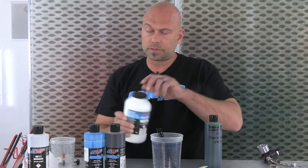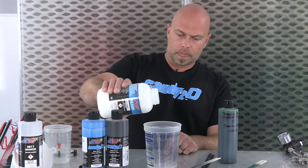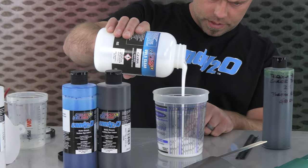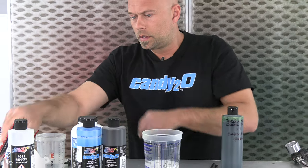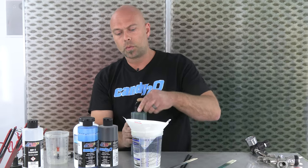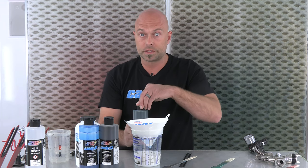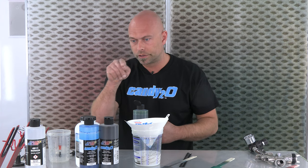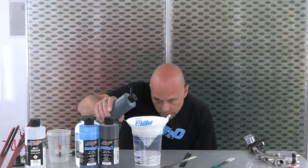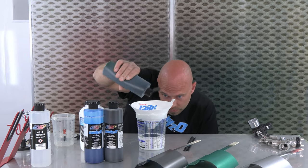As you guys know, if you're familiar with these videos, 4050 — that's our medium, that's our mixing base for our candy. I'm going to do this one at six to one, which is kind of my standard. If you want it to go a little bit lighter, you can go eight to one, but I'm going with six to one on this. I'm going to go right about to the four line. And I have a strainer — strain your candies. It's a 125 micron strainer, really fine, only because you get dried paint in the cap and lid — just cheap insurance. Anything in your paint, if you're familiar with spraying candy, you know it magnifies any kind of dirt or dust. It just doesn't go away. So it's really cheap insurance. Strain your candies. I went to four, going to the four line — and that is six to one.